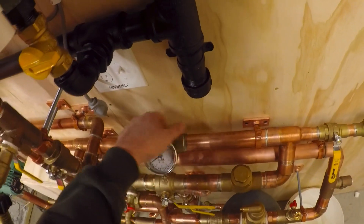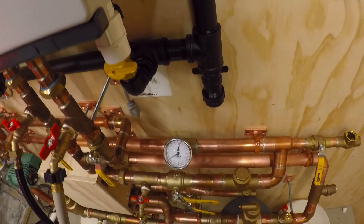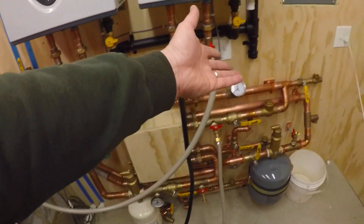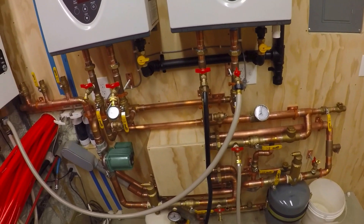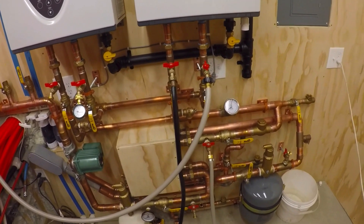Just a lot of fun — the kids and my wife were all wondering what was going on, but I didn't care and I wasn't going to stop right in the middle of soldering. My only concern in the world was that it fixed the leak, and it did. It's not the prettiest, but I hit both sides just because I knew if I fixed one and put it all back together the other would leak. Now it appears to be holding 45 to 50 PSI, so I'm good and I'm happy.